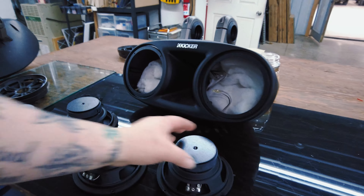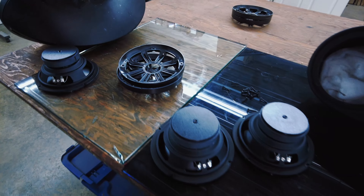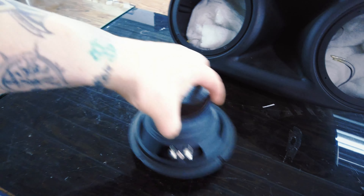The tower speakers aren't working correctly because they are blown. I've pulled them out and I'm reading 0.6 and 6.7 ohms on one pair - 6.7 ohms, 0.6 ohms - and 1.3 ohms on the other. So with the boat figured out and the remote start not being able to be done this morning, it's about 2 in the afternoon and I need to re-gear and do something else.